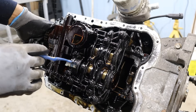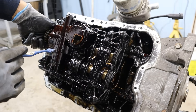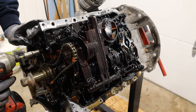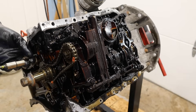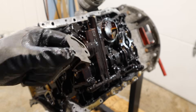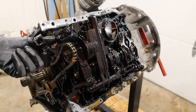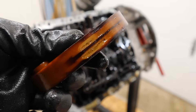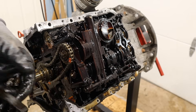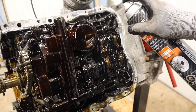We probably know why Kia engines fail — I think this particular one failed because the owner just didn't change the oil on time. That's why all this carbon has built up around the non-moving parts. I'm pretty sure some of this has clogged one of the oil arteries, causing a connecting rod bearing to spin. This part here is called a balance shaft to prevent vibrations, and on this side we have the oil pump with its pickup tube, which is actually surprisingly clean. The timing chain on the oil pump uses a strange-looking nut I've never seen before, and the chain tensioner here uses oil pressure to maintain tension — it's interesting that they put an oil-fed tensioner on the pump chain.